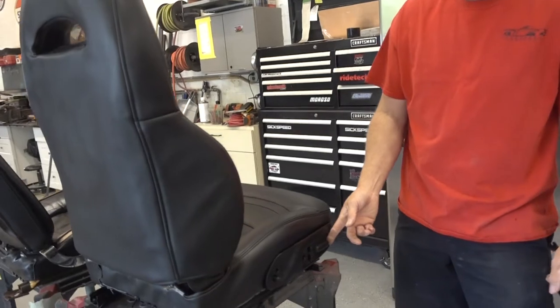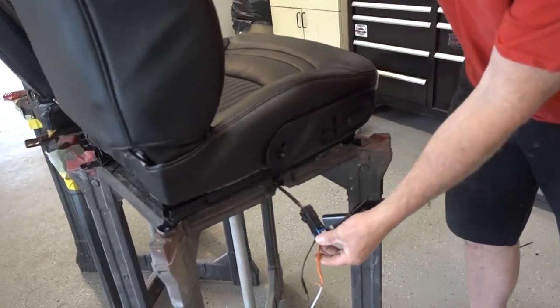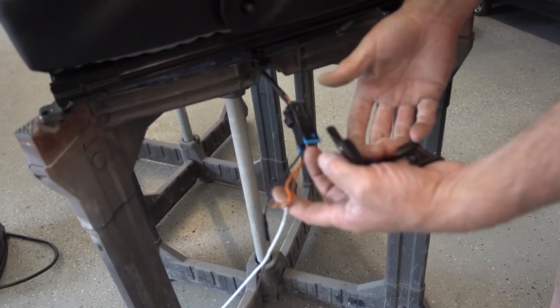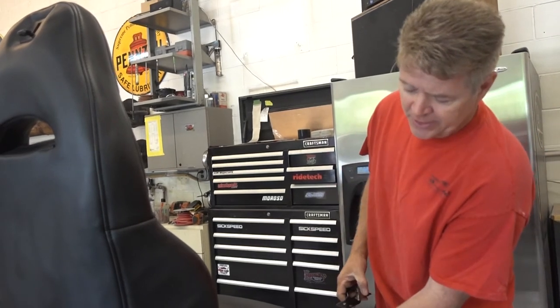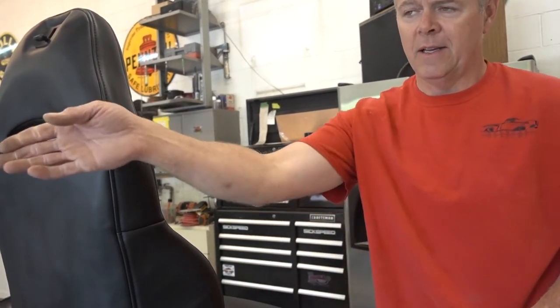With the seat wiring, black is your ground. On the passenger seat, there are only two orange wires — those are the ones you're going to want to use. On the driver's seat, there are like three or four orange wires, and again, those are the power and the ground. There's a bunch of wires on the driver's seat that you will not use, because they're for the airbag sensors, seat belt being buckled sensors, and all sorts of things you're not going to use in the older car. But that's the rundown on what we did, so he's going to have every function of the seat that was in the 2001, in his 1975.